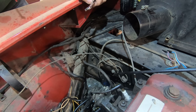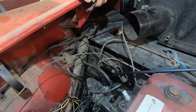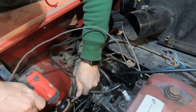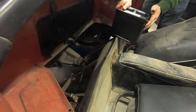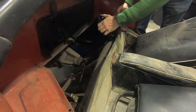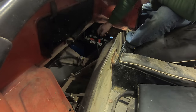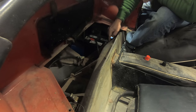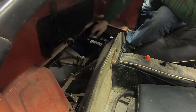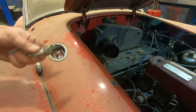It doesn't matter how much power you throw at the vehicle — if the battery cables are not in good shape, it's not going to transfer that power correctly. So I'm going to disconnect the two cables coming into the starter solenoid and get those cleaned up as well. Now that I have the battery cables changed back to top post, I'm going to throw this brand new Group 26 battery in. I think I want to turn it around so the hot terminal is not close to the chassis.